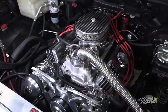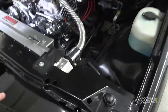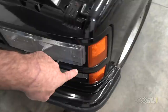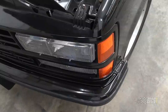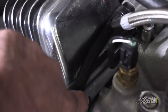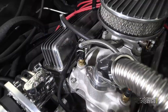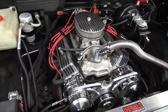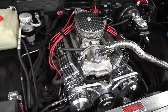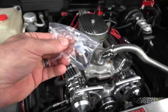There was another interesting find. I was sort of smelling fuel, and one of the reasons is the charcoal canister is up here and I've just routed the vent out behind this marker light, so I'm not surprised if I smell fuel from time to time. But what I found was — looking at this valve cover — I believe one of these fuel injectors is actually spraying out and misting a little bit. So I'm going to have to give Edelbrock a call. I certainly don't want fuel spraying on my hot engine. I called Edelbrock about this problem and they've already sent me a new fuel injector with new O-rings to replace the one I suspect is leaking. So thank you, Edelbrock.